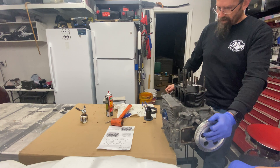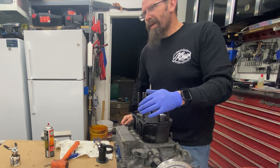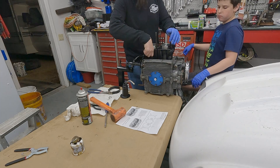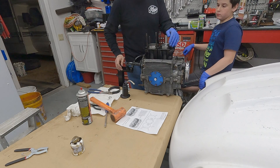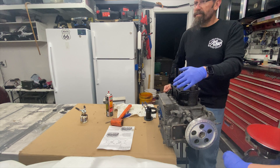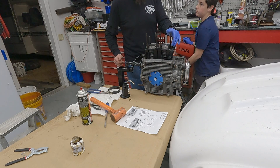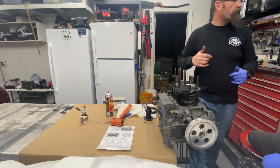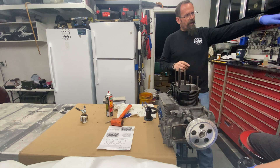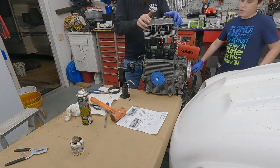Now, we were texting Kyle last night after I CC'd those heads — told him how we were going. He said no, you've got to bump that compression ratio up, and I agree. 6.4 to 1 is a little bit too low. So Kyle is going to be nice enough to give us a set of his heads that he had machined a while back — they have 48cc combustion chambers, and with those we're going to end up with 7.9 to 1 compression ratio, which is far better for performance. But in the meantime, give me a head — because we are going to temporarily bolt them on to keep everything in place. And also because it looks cool too.